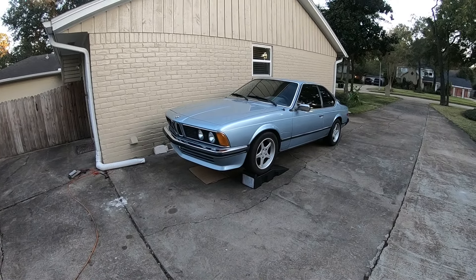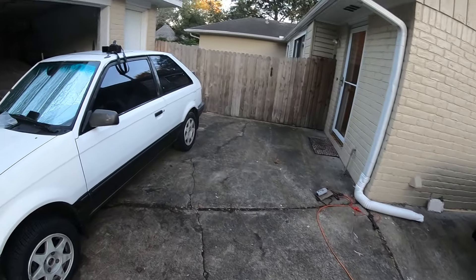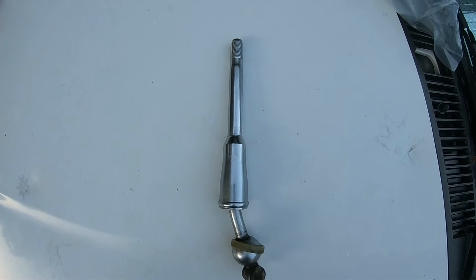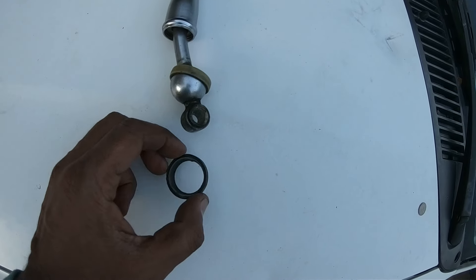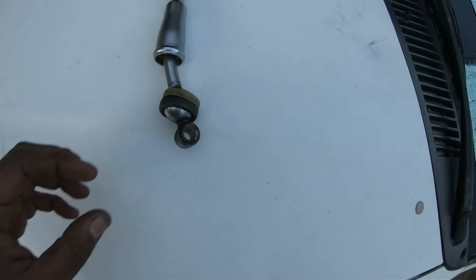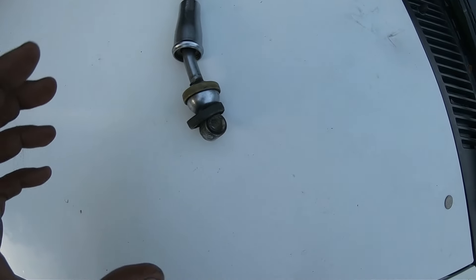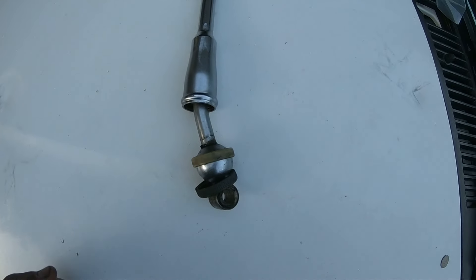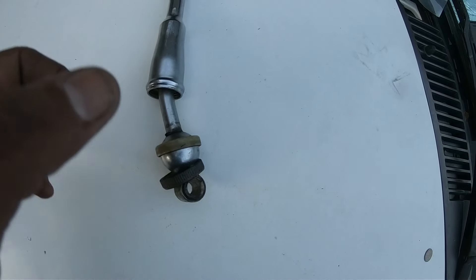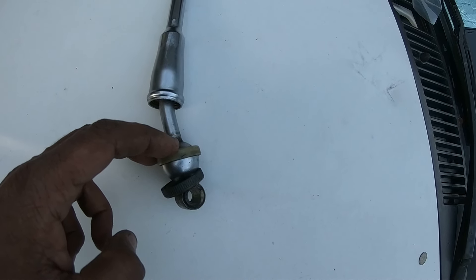I wanted this car to have a similar shifting feel — just make it crisp again. So I called up my good friends over at Ireland Engineering, spoke to George, and they knew exactly what I needed. Here's the old shifter mechanism from 1979. Nothing complicated — it's just a rod with a pivot ball and some plastic nylon-type bushings that cup the lower and upper part of the ball. You will need to remove some pieces from this to use with the Ireland Engineering kit. Specifically, there is a spring that sits on top, then a metal hat, and on top of that is a C-clip.